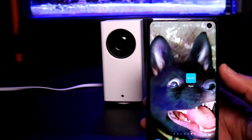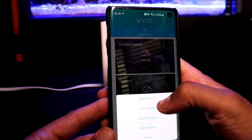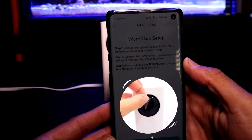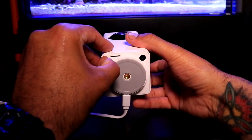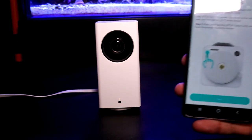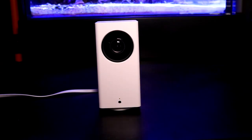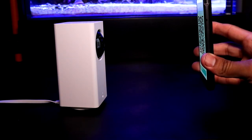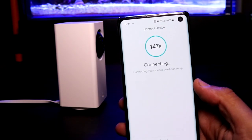So in my case I was adding a third camera to the app — you can see how easy it is to do. I just went to add product and then selected the Wyze Cam Pan. Here it's telling you to remove the protective plastic from the camera's lens. Another important point: this camera will only work on a 2.4 gigahertz Wi-Fi signal, not 5.0. Now flip the camera upside down towards you and press down on that setup button. You'll hear a pleasant voice saying 'ready to connect.' Next go to your app and search for the newly connected camera. You should see a QR code pop up on your phone's screen. Hold your phone displaying the QR code approximately six inches in front of your camera's lens. When your Wyze Cam reads the QR code off of your phone screen you'll hear a voice saying 'QR code scanned, please wait.'